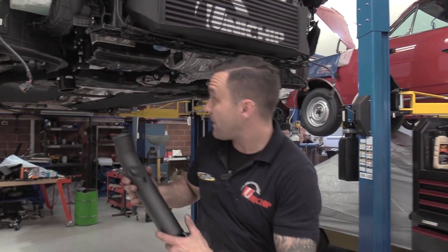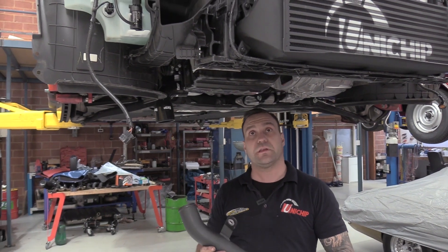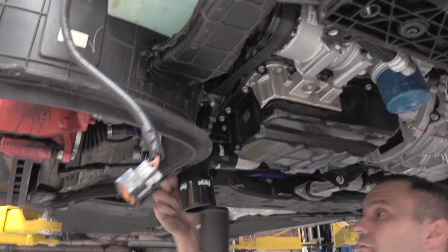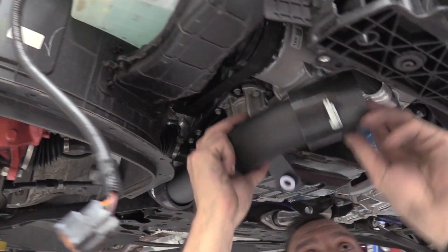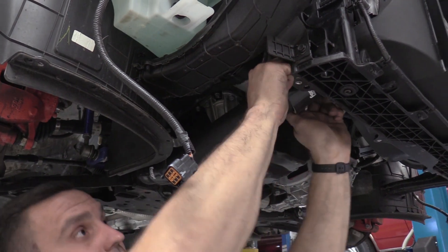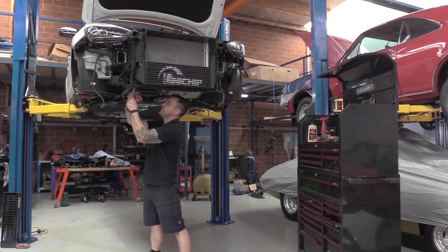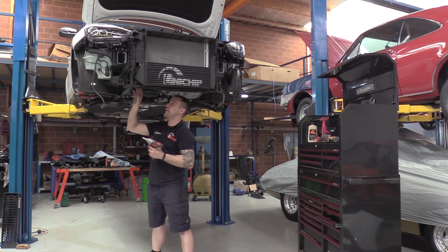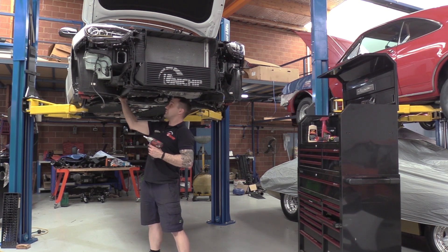This is the new hot side pipe. It basically picks up the existing hot pipe from the turbo, comes along the inside of the chassis and picks up the hot side of the intercooler. Fitted up the hot pipe, just putting the hose clamps on. Some people tend to put the hose clamps on and then slide the pipes over, but I prefer to open up the hose clamps and slip them on afterwards — it just gives me a chance to line up the silicon and everything a little bit nicer.